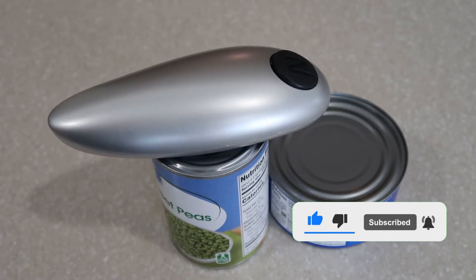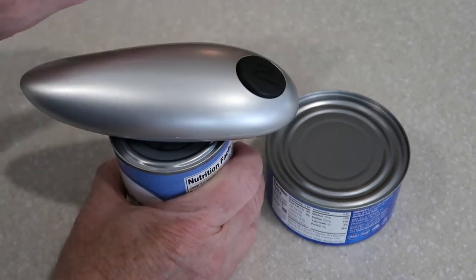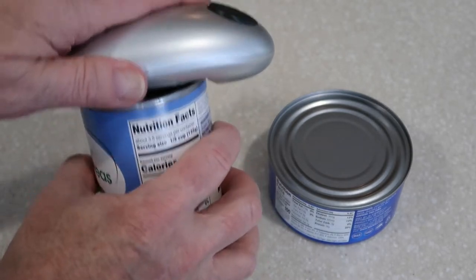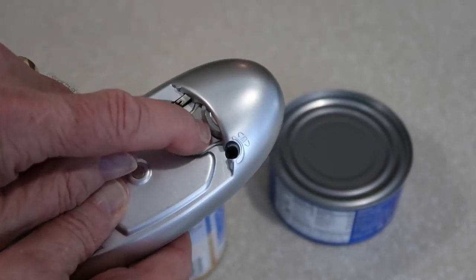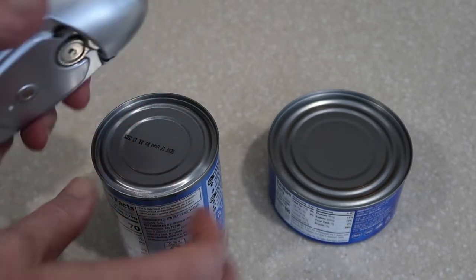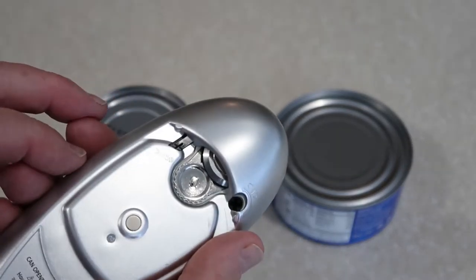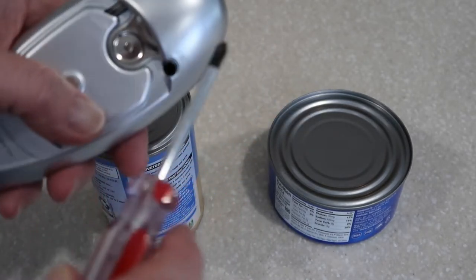Well, that didn't do us any good, did it? The demonstration isn't real successful so far. You can see the cutting edge is now sticking out, and it wasn't like that before. Maybe it's stuck — I can't get it in there. Right away this is creating a problem, because that cutting wheel is stuck and I cannot get it to attach back to the can until that retracts. I don't know how to get it to retract. Let me see if turning that does anything — that appears to force the wheel to turn. Maybe if I let it go, it'll eventually think it's done and retract.